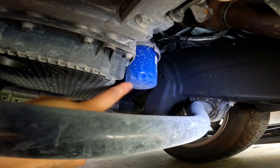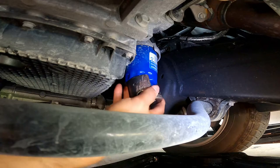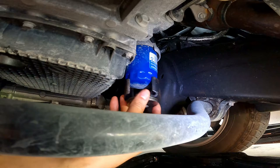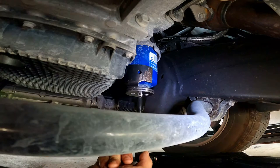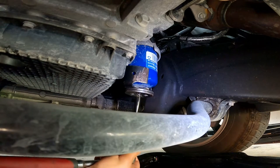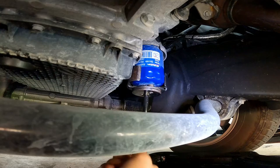Now it's time to move on to the oil filter. One thing I forgot to mention is this clamp, which makes it a lot easier to remove the oil filter rather than using your hand — you can find these at any auto parts store. Put the tool on the oil filter, connect the extension, and use the same ratchet turning to the left. Do this until you loosen it enough where you can turn it by hand and won't need the tool anymore.